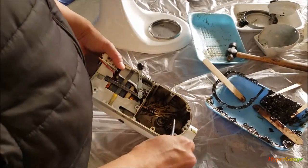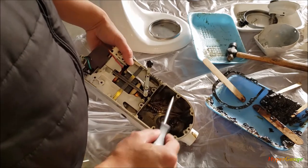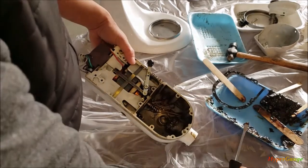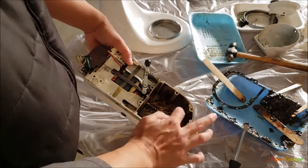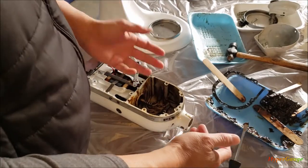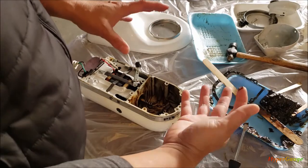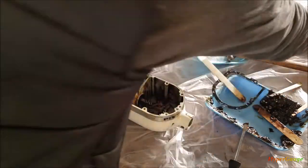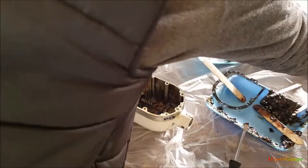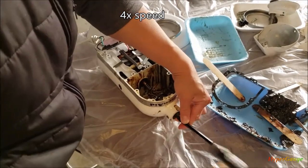All right, I don't know what happened here — this gear is supposed to slide right out according to the diagram I checked, but even trying to use a screwdriver I couldn't pry it out. It moves freely though, so I think the next step is to use the punch to try to tap it out and slide the whole thing out. Also, it's so messy and greasy, I'm all out of gloves, so I have a new stack of cloths. It's gonna get messy from here on. The factory hub gear is actually very tightly installed — it took a little more force than I expected to tap it out.